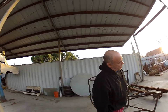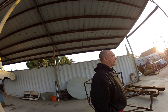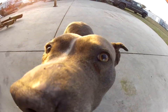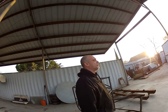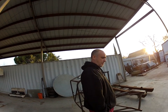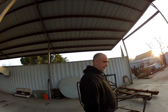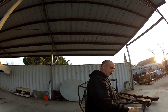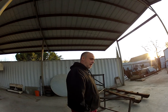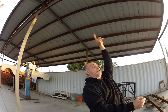Well, I don't want to sit here and say I know all about it, but I've seen enough on the internet, and I've already done it a couple times. The El Camino, I got it launching really good. The instant center is the big deal, man. If you can get that all figured out, depending on where you want the center of gravity of the car, and the Z-axis, it's basically like running with a big stick. If you got a really big long stick and you run, the stick goes back.